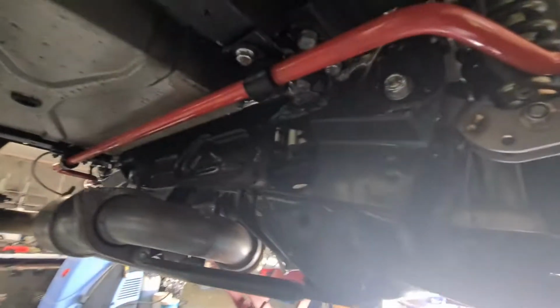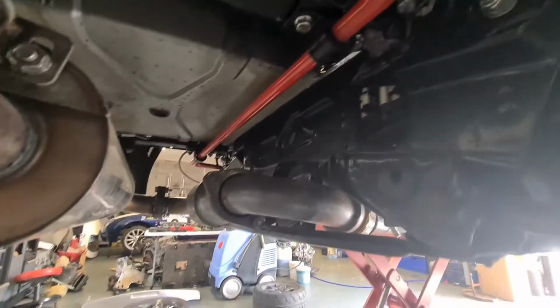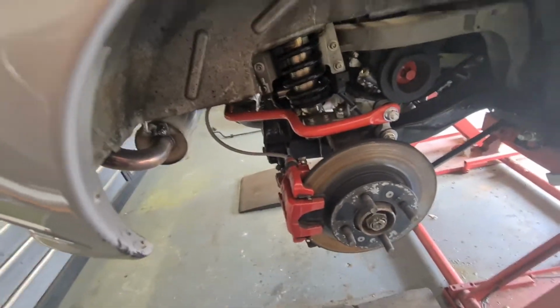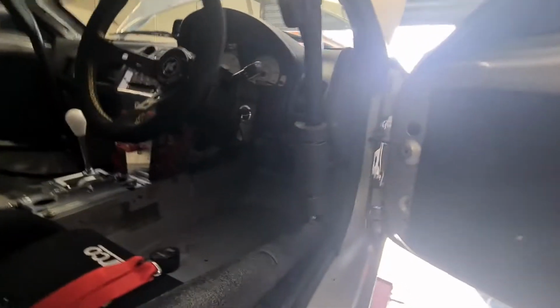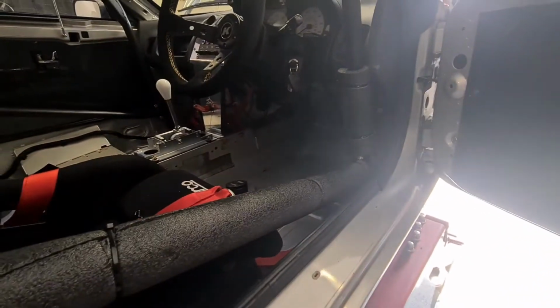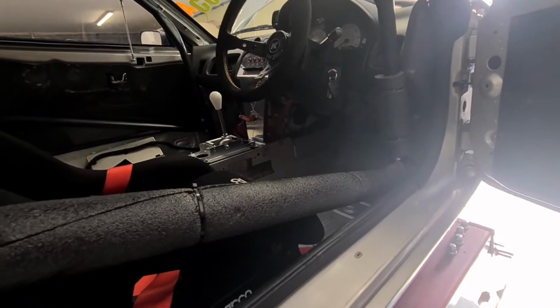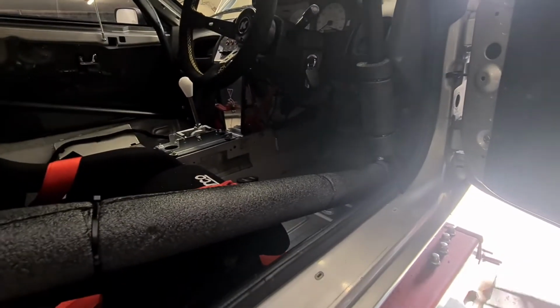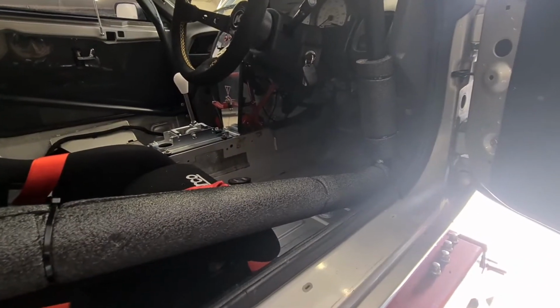Just a quick look underneath there, so it hasn't got the offset plates on anymore. More poly bushed up, Black Series. So I think what I'm going to do is put the computer on it now and see what that ABS fault is, and if it comes up with the rear sensors. Normally if there's a glitch fault, disconnect the battery for 10 minutes and reconnect. Well, this has been disconnected now since March. So over a month.